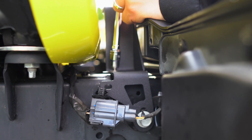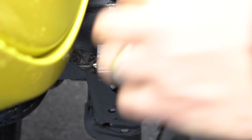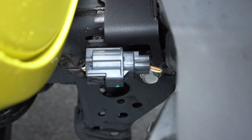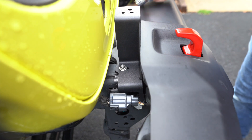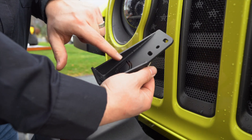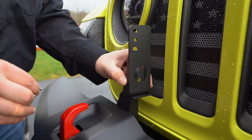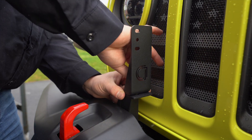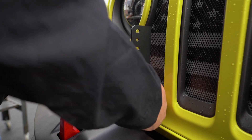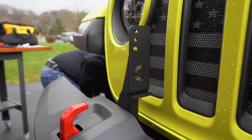Let's get that snugged up. That clips back in — and that is sick, guys. They even put a little standoff here; they machined an entire new bracket just to make sure that can clip on. That's what you want in a company. The next thing is to loosely attach this bracket onto either side. You'll know it's the right side because the Diode Dynamics logo will be facing forward. Since we are running the crosslink, we're going to get this lined up, drop those in, and put the flange nuts underneath. This can slide based upon how far the lights need to stick out.